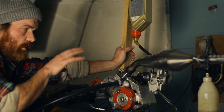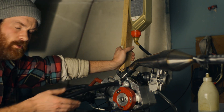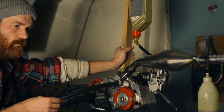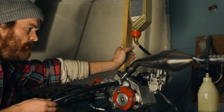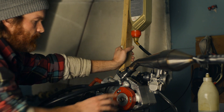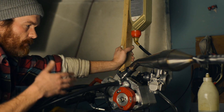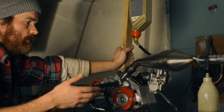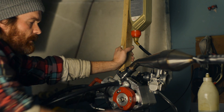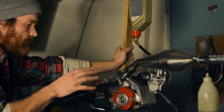Welcome back. In the last video, we started the engine, but I forgot to turn off the choke. Now, without the choke, it's still running rich. I tried changing the main jet from 130 to 110 - it doesn't really help. With the massive case volume, it will act rich to the point where it's really lean, but still act rich because it will kind of act like a case leak, at least at low RPM.